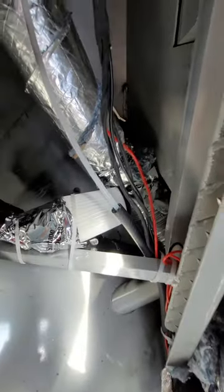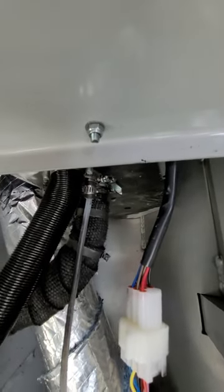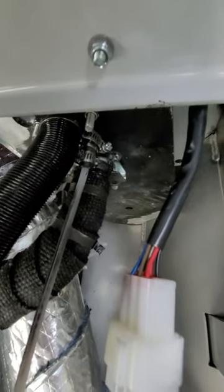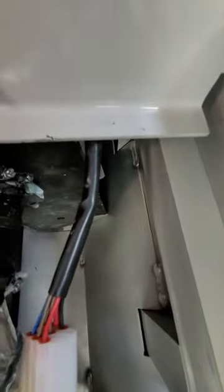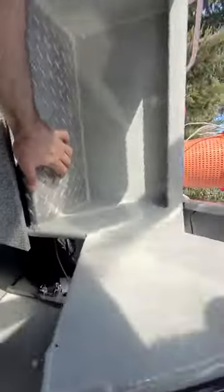You can see my rubber hose - it runs out and that's where it terminates the hard plastic, then goes right into the heater. To mount it, I took a piece of plate aluminum from another project and cross-drilled it. Then I mounted it to my side strut and to another piece of aluminum up in the front of the bow so that I don't make any extra holes in the boat.